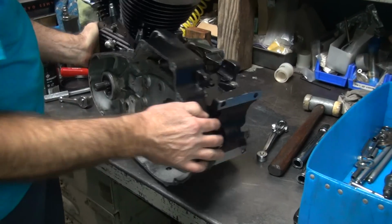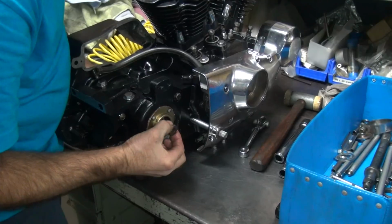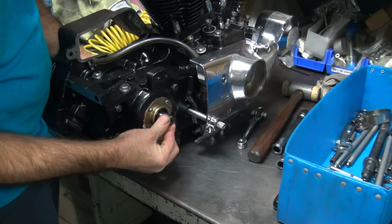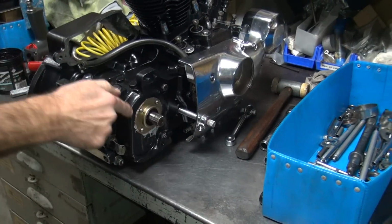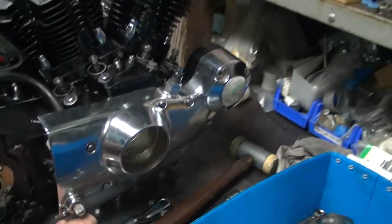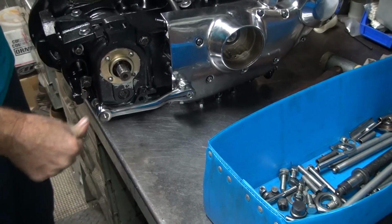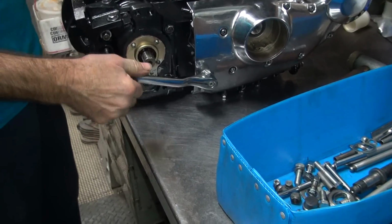Okay, so first thing we do is check the clearance here. See that clearance in there now? Yep. See, people see that much, you get scared. When you push that in, it drops down to just that. But now we've got clearance, so now you've got some room. You can pull the clutch in and hold it at the stoplight like a dumbass, and you're not blowing it up. See how it springs back? Better now, yeah. Still a little gummy, but it springs back.